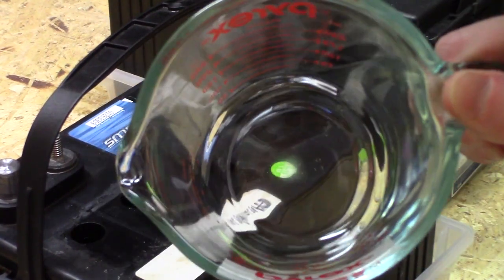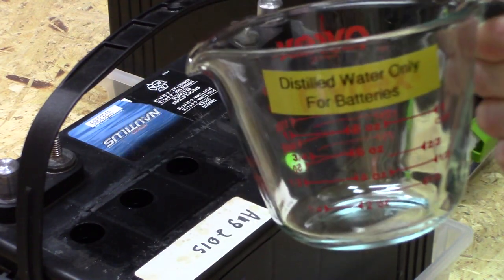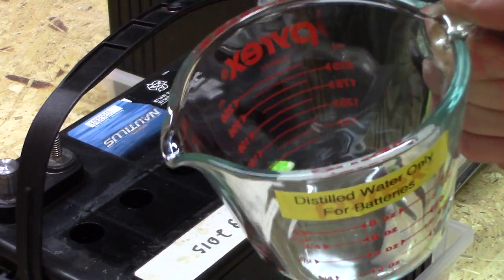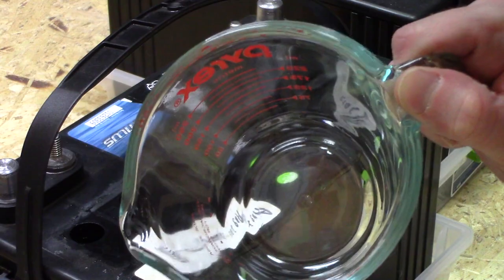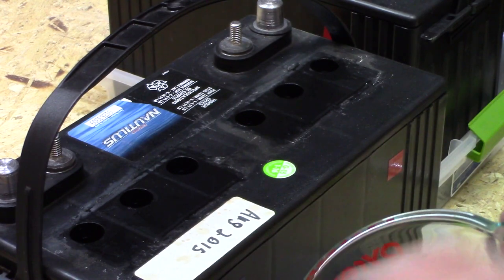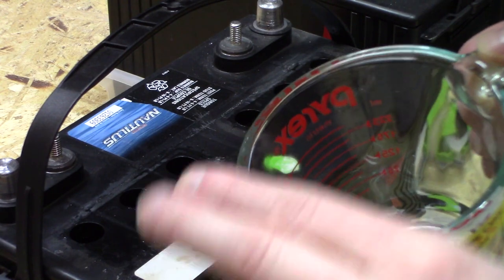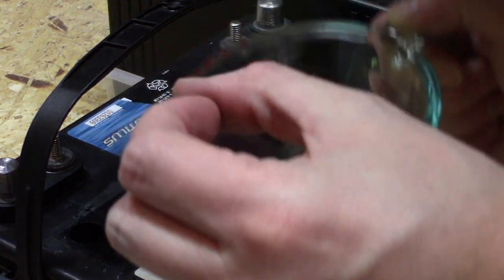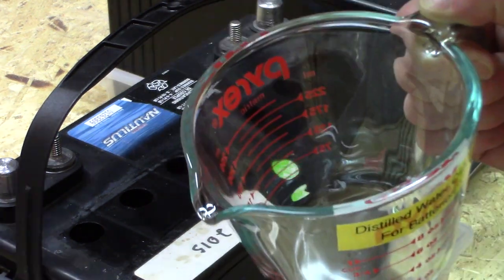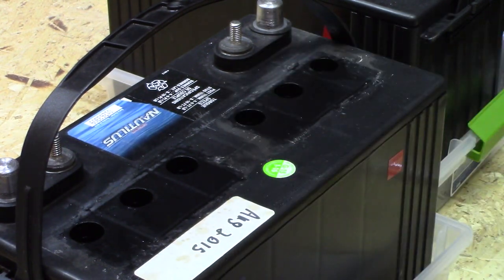What I usually do is fill this Pyrex with distilled water, keeping it clean so there are no contaminants — this is a delicate job and you want to make sure you don't get any contaminants in there or it could damage the batteries. I put water in and basically dump it in the cells. I try to fill until I see the water level go up to the little plastic lip — there's kind of like a little pipe and the pipe ends, so I try to get it all the way to the end of that pipe. That's what I consider full. When I bought the battery I checked that level and I just try to match it.